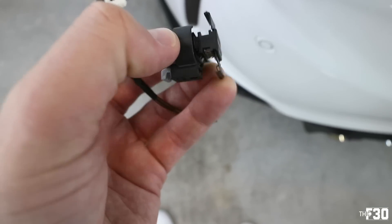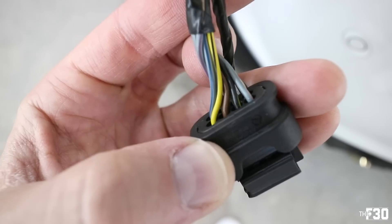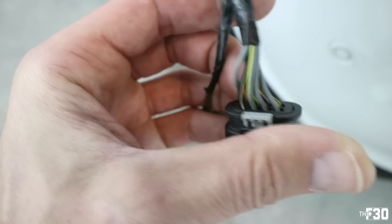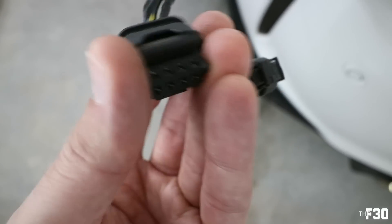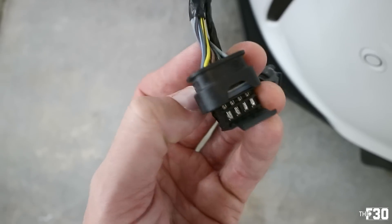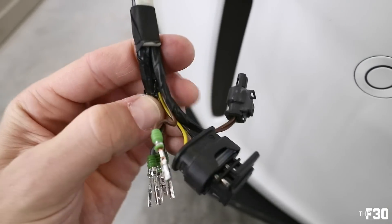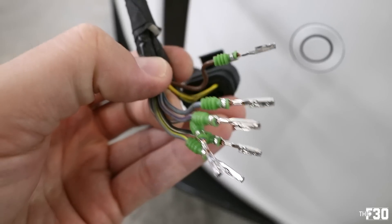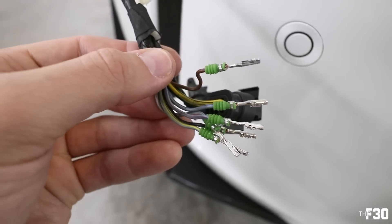To expose the pins, there are two little plastic pieces folded down — just peel them up. On top you'll see two yellow and black wires on each side of the brown cable. Those are the two you leave in because we're not going to use those. We're pulling out the brown one, the gray one, and all the ones down here. To pop them out, push in from the top with a pin tool and push out from the side — the pin should just come out. Then throw those pins into the new connector with the correct orientation from the chart. Super easy.